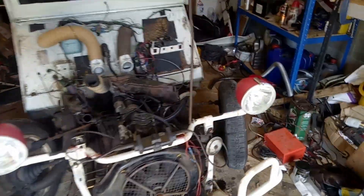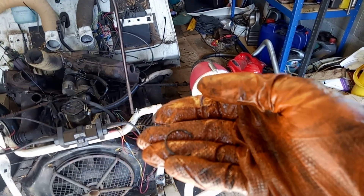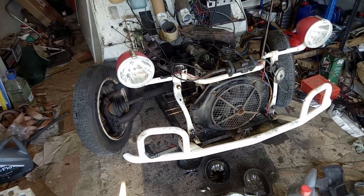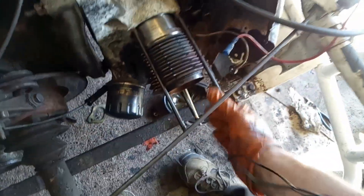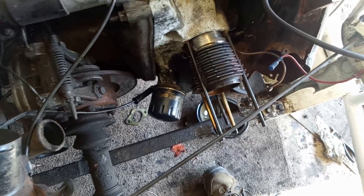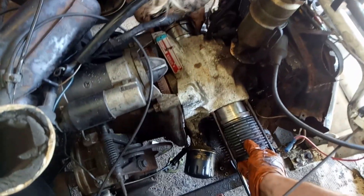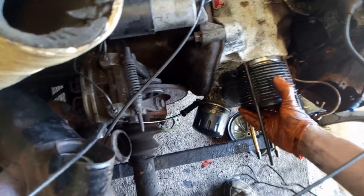There's one slight difference between the two pistons: the originals are held in with tiny little clips inside the pistons, whereas the Burton ones have little circlips, which is better and less likely to ping off and damage your eyes. We wind the pistons in so we can then get the barrels seated. Apparently that's a lot easier to do with two hands. There they go — fully home. 652 pistons and barrels are in.